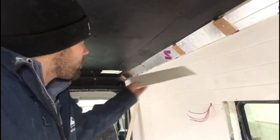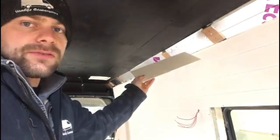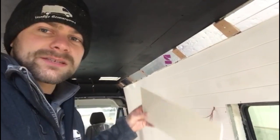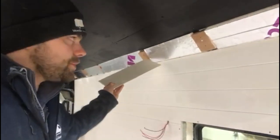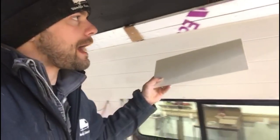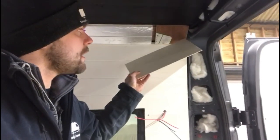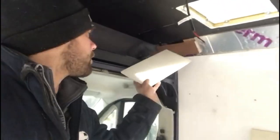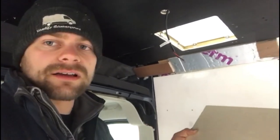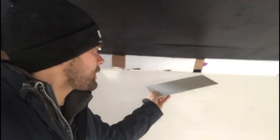At the bottom of the window we're going to have a piece of worktop cut to shape to look like a window sill. With the wall and ceiling in, you can see this top corner piece — we like to put this at an angle and make some coving for it. I've packed out the structure using 18mm plywood doubled up so it sits proud of both wall and ceiling. I've made sure it extends to the very back of where the wall's going and also packs out to where I want the coving to stop at the front, so I've got structure to fix into at both ends.